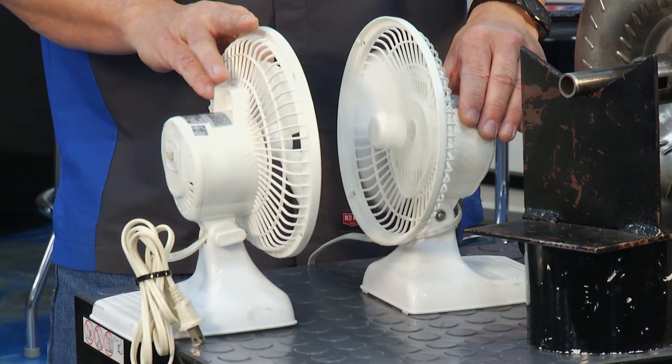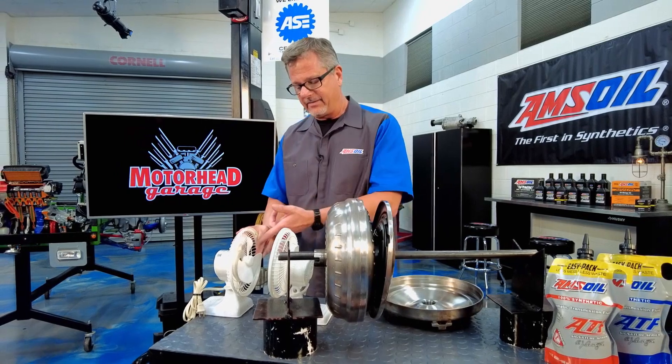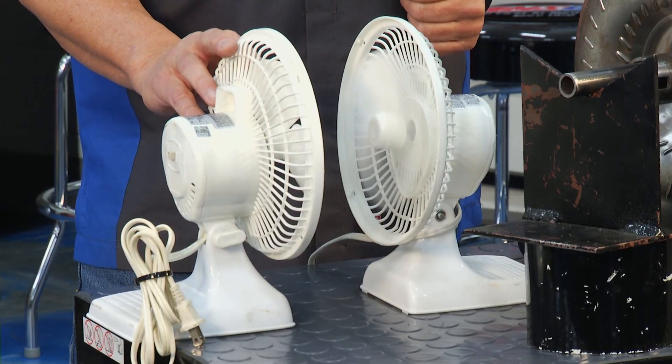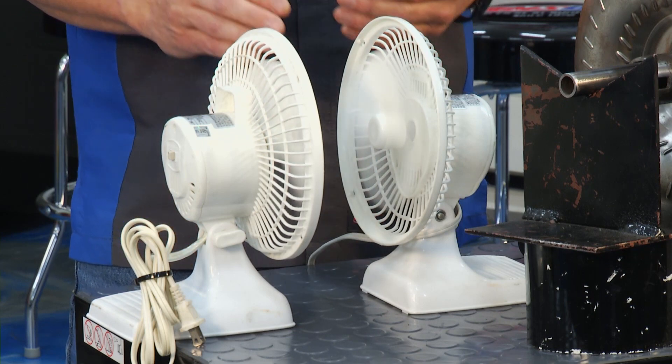What's happening here is this would actually be bolted to the engine, so this is spinning at engine speed. When I'm at idle, well, it's stalled — this hand's not moving. I'll show you that in a minute. Then what happens when you take off? We start multiplying torque, and then eventually it gets up to coupling phase.